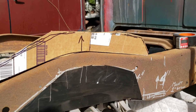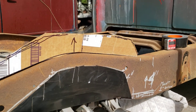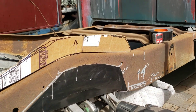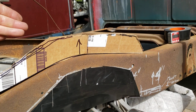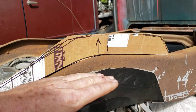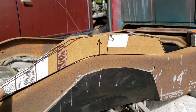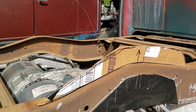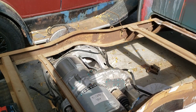And this is what I'm going to do to the frame rail: this section gets cut out, this gets added, obviously all going to get boxed and gusseted and strengthened. The coilover will mount right here — that might require a little trimming of the inner box. This height is determined by where the bed mounts and how high the bed mounts over this portion, so it's actually going to be about right here because I don't want to get into the bed. Anyway, so there you go — video number one, Tesla Model S Sport drivetrain in a 49 Studebaker pickup.